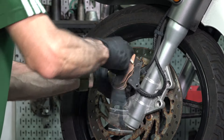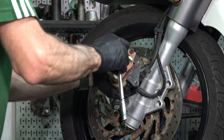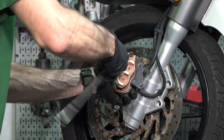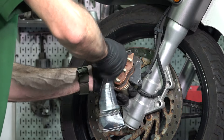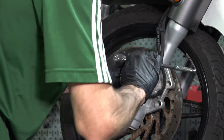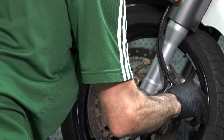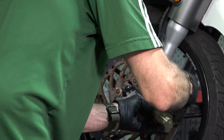If you're going to reuse the rotor, you probably want to burnish it. You don't really resurface them like in a car, but you could take like Scotch-Brite or even 80 grit sandpaper and kind of break the glaze. You want the new pads to kind of reseat, so you could sand the rotor all the way around. But we're just going to leave the caliper hanging because we're going to move on to removing the tire. Hopefully you didn't skip through this whole part if all you're looking to get is how to change a tire.